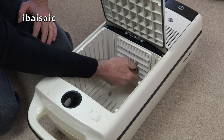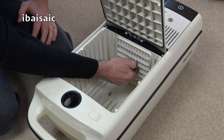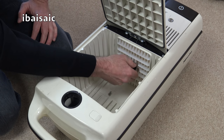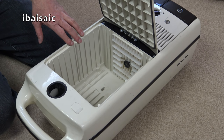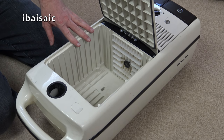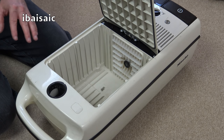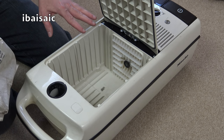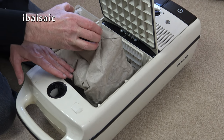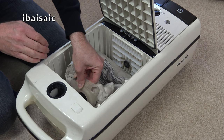I have been online before I even put a bid in for this, and I didn't pay a lot of money - it was under £20. Before I bid, I had a look to see if I could get a motor or carbon brushes for this. I can actually buy a compatible Miele motor designed to fit this - a branded proper Miele motor - but it will cost me about £100. So it all depends. If this cleans up and it isn't just the suppressor that's blown, I will probably fork out for a brand new motor.